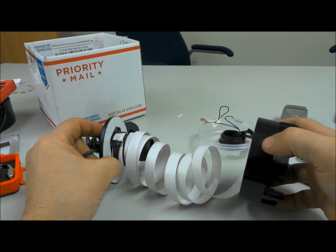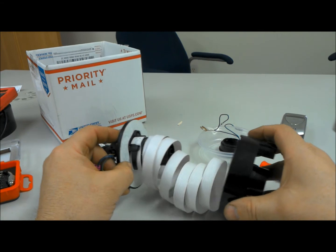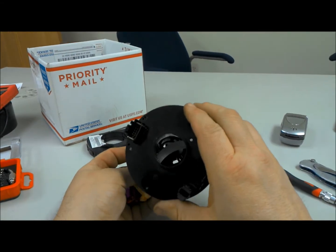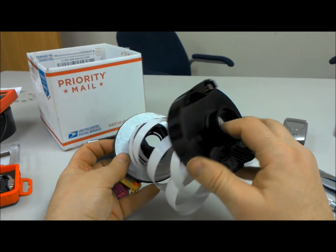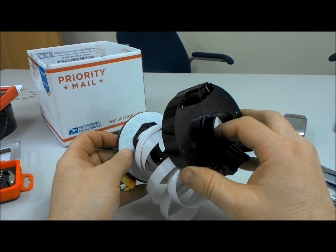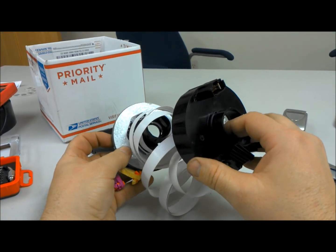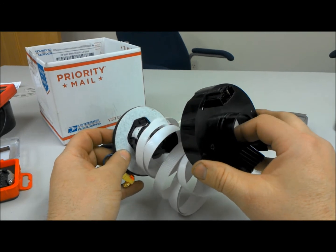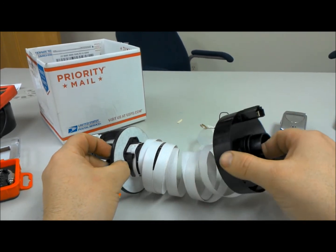So that it never binds up all the way. As far as how many turns it's supposed to be, I have no idea, because it came apart on me and it was all messed up. When you remove this off of a Smart car — this will be on the steering wheel — it's actually got a limiter somewhere in here that will not let it turn past a certain point after you've removed it. It still probably throws the calibration off somewhat, and you need the MB-STAR system to get it calibrated — you go to your dealer and get it done.